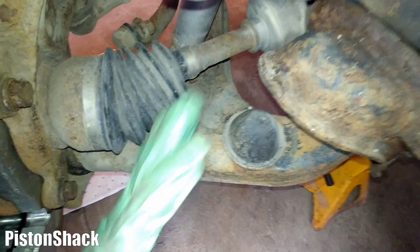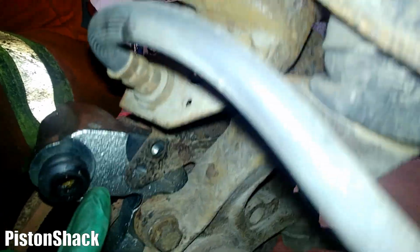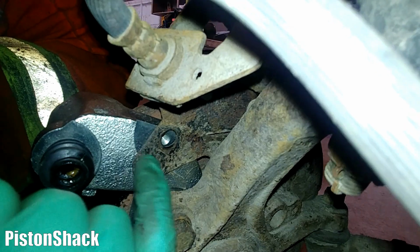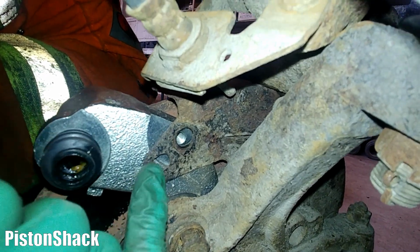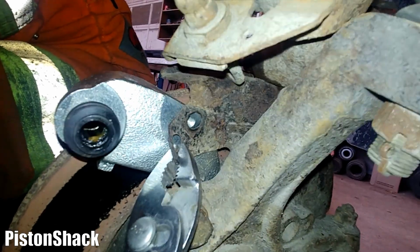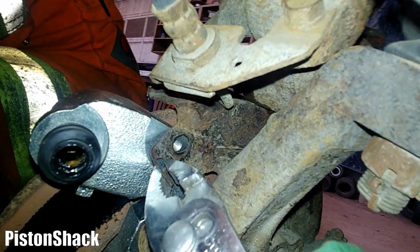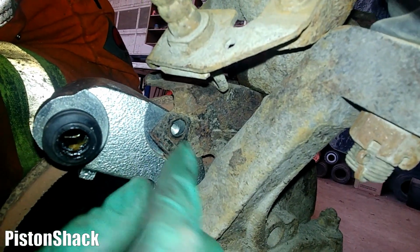Beautiful. All right. I have a new bracket. See, nothing is rubbing. It's in place. The brake caliper bracket has a slightly different profile over here. As you can see, there's a step. It's a dedicated groove. We're using the second hole anyway. On the original one, this dust shield just went flat, and on this one it doesn't. But it doesn't affect anything. It just will go with the pliers. Just bend it like that. Make sure it fits nicely in the groove, and it won't affect anything. Yeah, something like that. Yeah, well, dust shield adjustment.